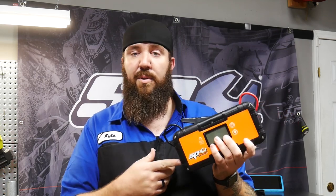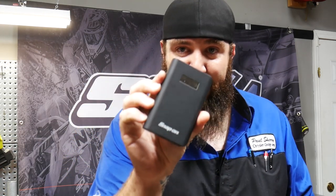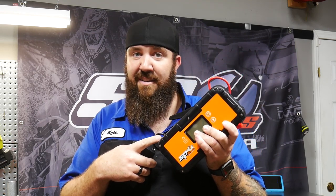At around 5 to 6 volts it's going to take about 30 to 45 seconds to be jump start ready. There are also other ways to charge this. With the internal battery — if you've plugged this into a wall overnight — you turn it on and it takes the energy from the battery and puts it into the ultra capacitor. That takes about 4 minutes, because it's a tiny 6000 mAh battery — about half the size of the Snap-on pack. At 4 minutes it will fully charge the ultra capacitor enough to jump start the car. To put that in perspective: half that battery, which only powers a cell phone two or three times or runs a heated jacket for a couple hours, is able to jump start a car with an ultra capacitor. That is just crazy.